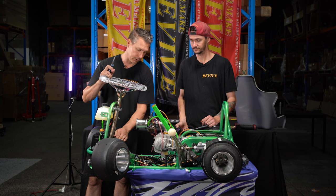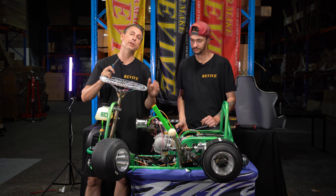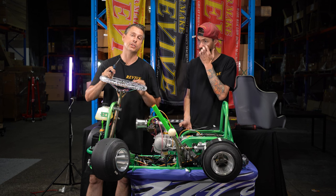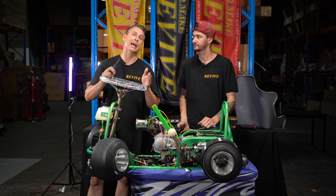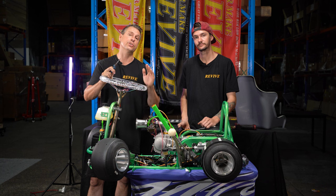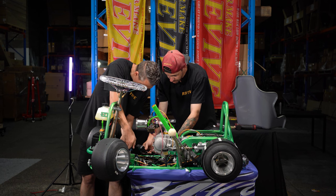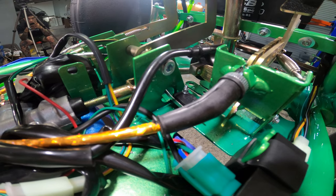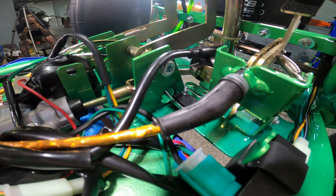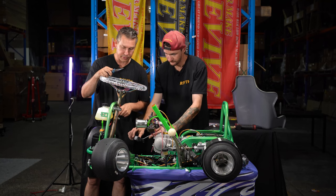So I'm going to push on that pedal, and I have to push on it pretty hard to get the micro switch to click. So I'm going to bend the actuator arm on the micro switch, just so as soon as I touch the pedal, it clicks on and off. I'm here now with the needle nose pliers, and I'm just going to bend that arm ever so slightly. Now if I push on the pedal, it works perfect. So a little bit of a tweak on there.